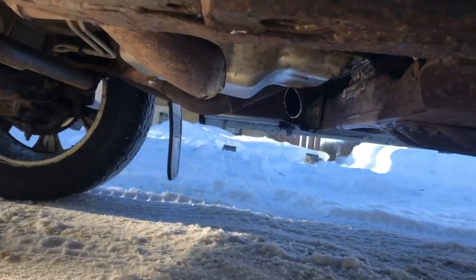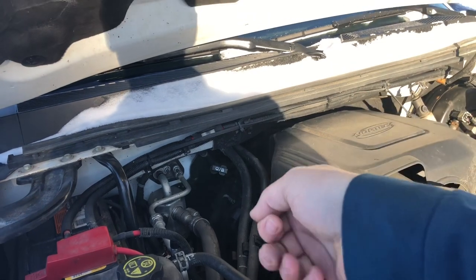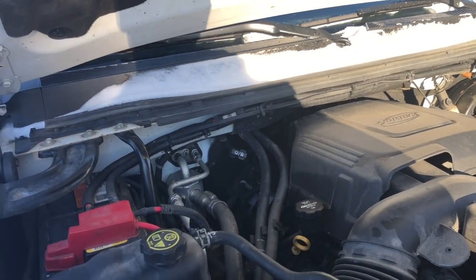We're letting the truck sit in neutral. Letting it warm up — the transmission's got to be in neutral while you're checking the dipstick. Clipping down the highway pretty good. Everything looked good. Transmission fluid is all good. I do not recommend driving with open headers — it is very loud in here. I'm going to end the video here. Thanks for tuning in. Hit that like and subscribe and the notification bell so you can see when I'm wrenching on my stuff.